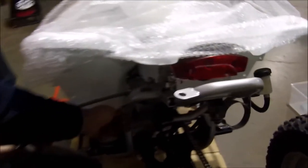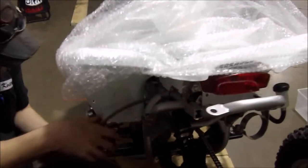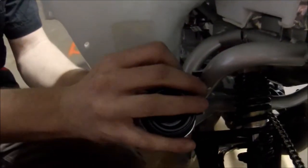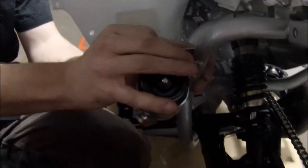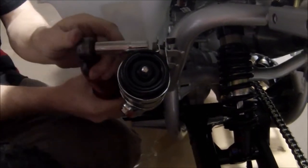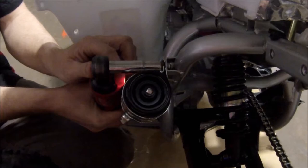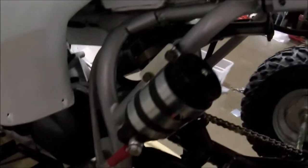The bolts are already in the chassis here. So he's mounting the reservoir and since the clamp is brand new, it's going to give you some resistance — it's going to want to open up. So you really need to clamp it closed and then run the bolts in, just turn it all the way in. There you go, he's got it set up. That's your finished reservoir.